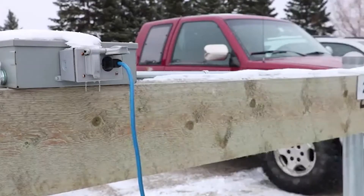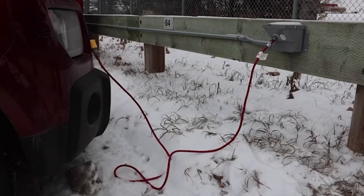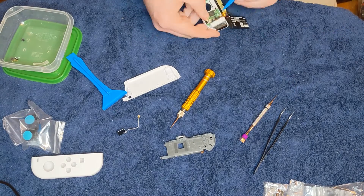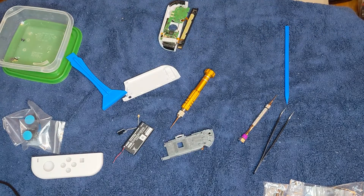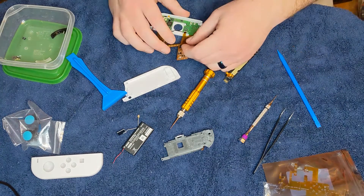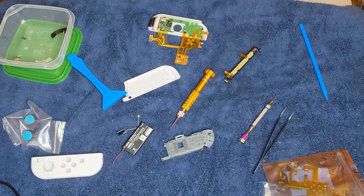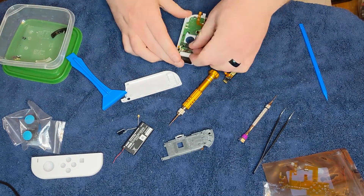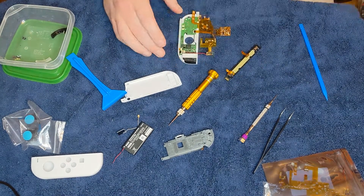The actual mod wasn't too bad. Basically, the LED lights work as a pass-through — think of it like an extension cable from your outlet to your device. Everything that the Switch connects to is modular. The motherboard inside has a bunch of ribbon cables that attach to it, and so all this does is everywhere you plug in a ribbon cable normally, you plug this in. And even with the battery, you plug this device into the motherboard's battery slot, and then the battery for the Joy-Con plugs into the LED battery slot — kind of like when you put multiple Christmas lights together.